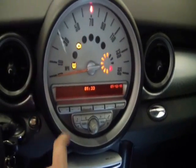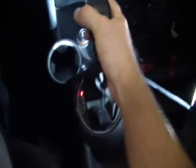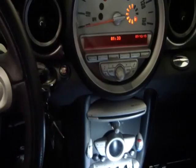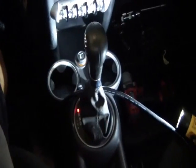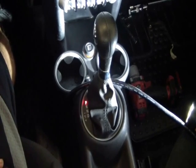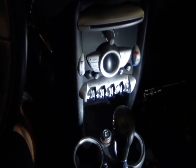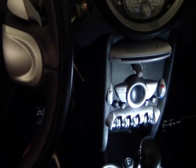How it should work is: when the ignition is on and you press your foot on the brake, the solenoid inside pushes that little white plastic piece that I welded back together, which unlocks it and allows you to pull it back. Let's test this out. Turn the ignition on until all your lights come on. I'm not touching the brake — can't get it out. I push the brake down — boom, there we go. You can even feel that solenoid pushing that piece of plastic. This will save roughly $150 to $500. All it was was a little bit of time. I've got my MaxiDiag connected to clear the A0B6 shift interlock code out of the computer.